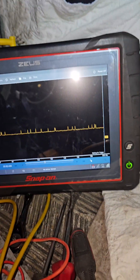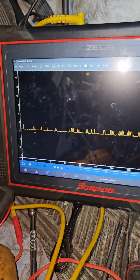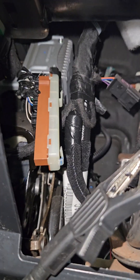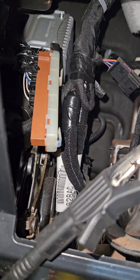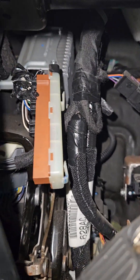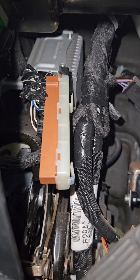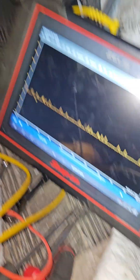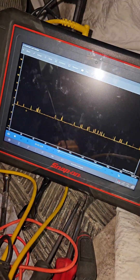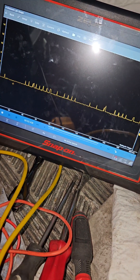Now I tried to reproduce the issue, took it apart, put it back together, and now it won't do it anymore. I won't take any chances because it could be the wiring loom, not just the module — but chances are it's the module under the seat that's defective. I spoke to the customer and told him I would deactivate the seat heater for now. He doesn't really mind — he prefers the rest of the car working over the seat heater. So we're leaving the connector disconnected right here at the IHS star connector.